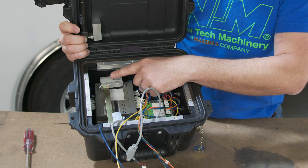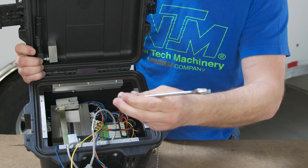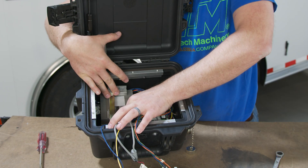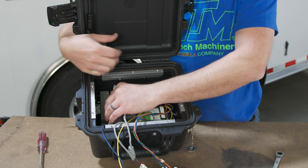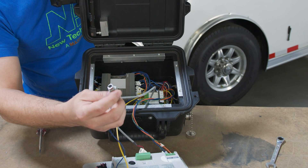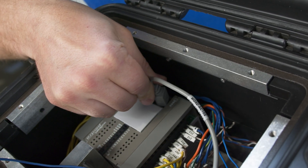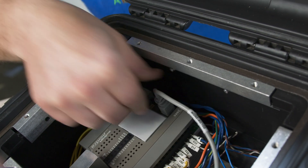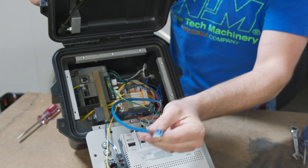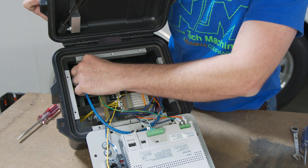What we're going to do is pull this controller out of the way. First thing we need to do is get this bracket out of the way so we can plug back in. In this version of the PLC, we're going to use a 7/16 wrench. Bracket removed. Now we want to make sure that we correctly align our pins — we don't want to damage them, so take note of the alignment pins. This is another type of communications cable that you may have; it's the same concept. Just make sure it's firmly pressed to the PLC — you want to hear a solid click.